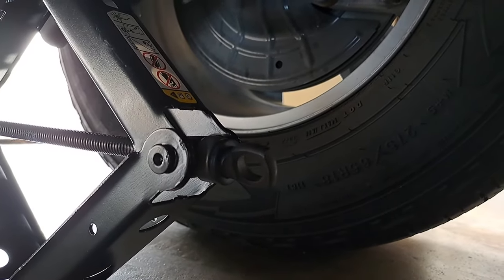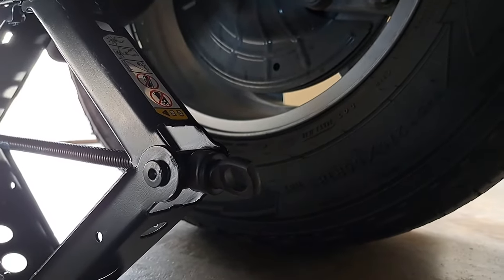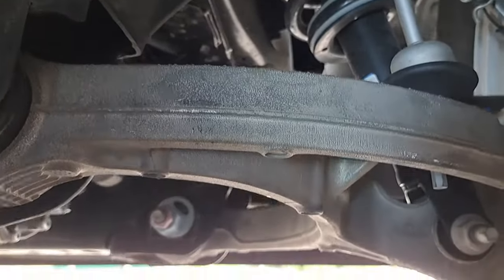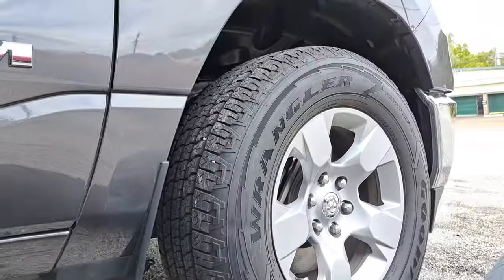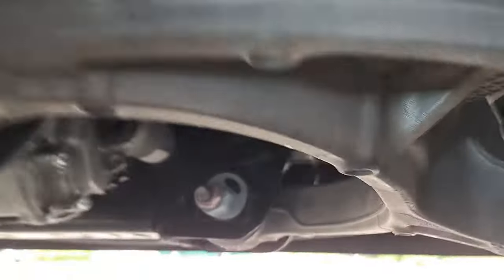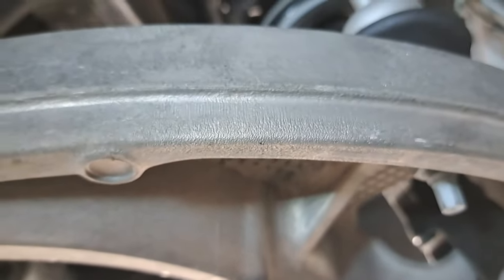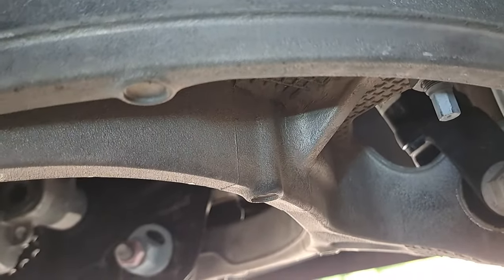For the rear, that eyelet will probably need to be facing towards the rear — it's the only way you'd really have access to the hook and the extensions underneath the truck. The front does not have individual jacking tabs. Where those tabs will slot, you can see some witness marks right there on the back side of that lower control arm.